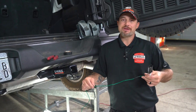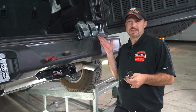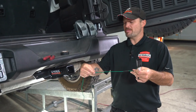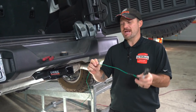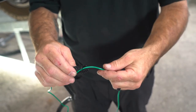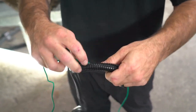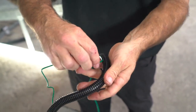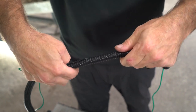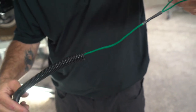When we wire up this Jeep, we're going to get very close to the exhaust. So in order to protect these wires, we're going to add some protective wire loom. We're going to start about six to eight inches from the T-connector and cover the rest of the green wire. An easy trick for putting on the wire loom is to attach it towards the back and by pulling it in, you can help pull it into the plastic. Now we can find our six to eight inches and tape it back.